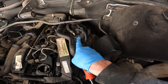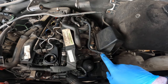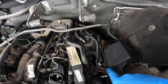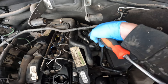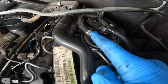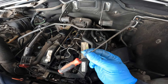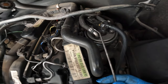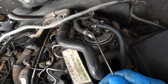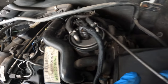And here is the fuel filter. That hose is for removing any water if water ever gets into the fuel lines - that's the fuel lines sensor. For removing these fuel lines, you see these small clips here - you really just need a tool like this, and you can just pry it and clip it off.